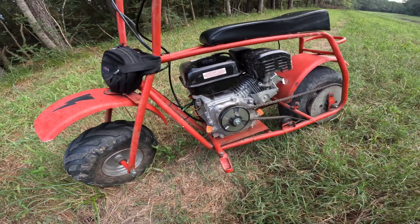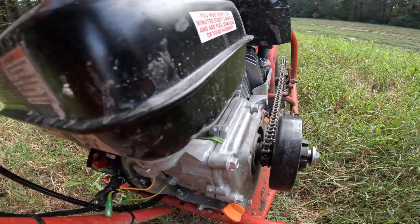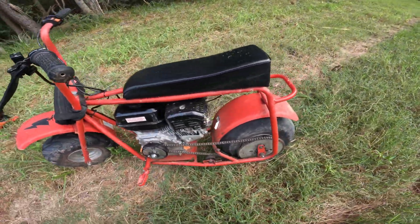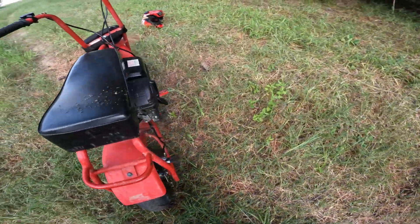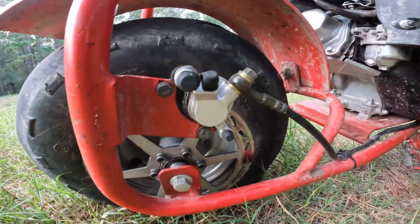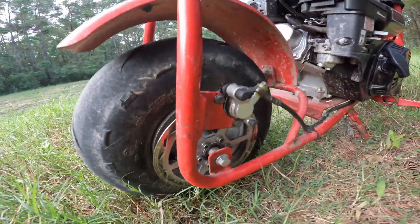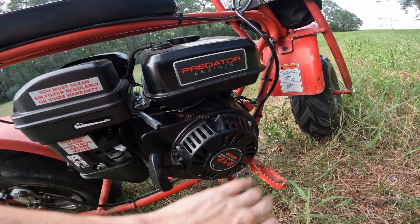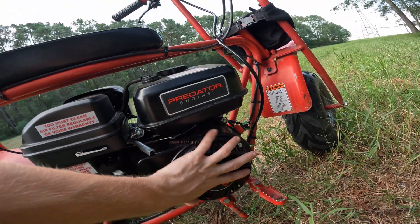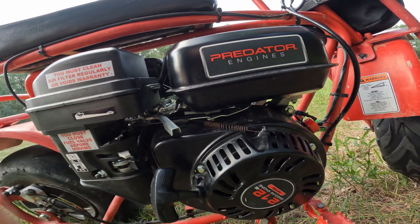Now let me show you the build in detail. Here's the clutch mounted backwards to give the engine more room to slide further inboard on the bike. Here's the new chain. Here's the new hydraulic brake — it mounts right onto the original cable brake mounting plates, but with a rotor. I also turned the pull start around; usually it faces the other way, but you just unbolt the screws, take it out, twist it, and put it back in. Down in there is the governor delete, and I added a spring to make sure I had a good throttle return.